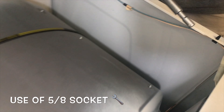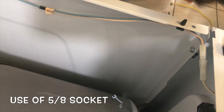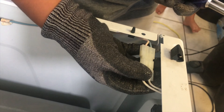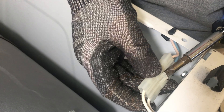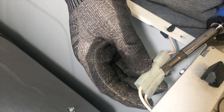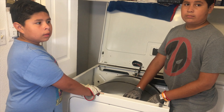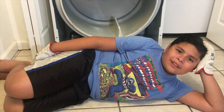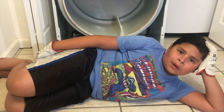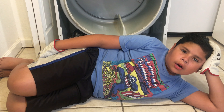Now you're going to want to unscrew the two screws at the top of the door using a socket screwdriver, and then very carefully detach the door sensor. Do not destroy this or mess it up because it's going to cost you a lot. You can use your fingernail or the flat edge of the double-sided screwdriver. Have some assistance holding the drum — lift up then pull the door back. Life hack: find something five inches tall and wedge it under the drum so you don't have to hold it all day.